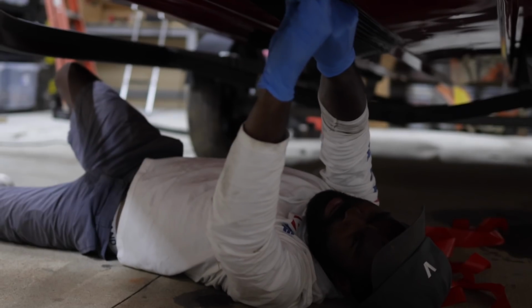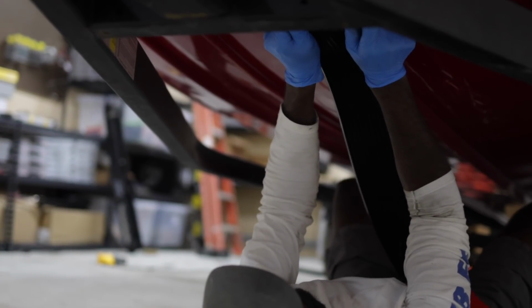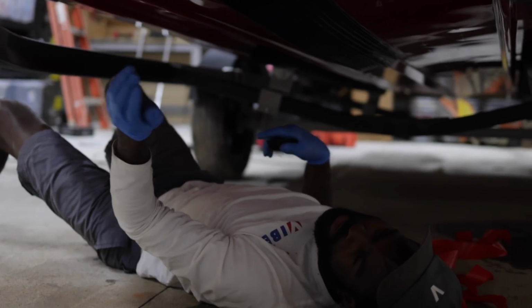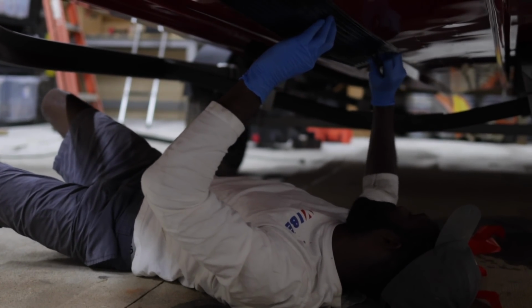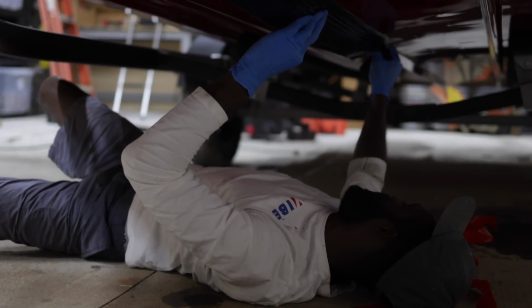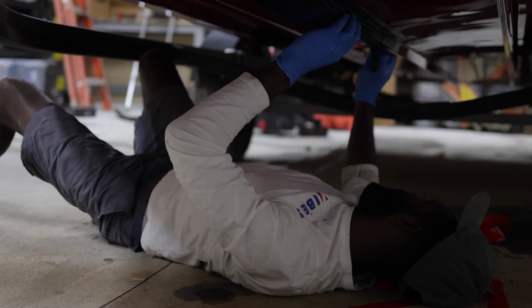Okay, but the material helps guide your squeegee along the material, and you get good contact. The other thing it does is it makes the keel protector itself really pliable, so it'll bend around. If you look on this keel protector, my midrib, that's a 1/2 inch vertical 90-degree angle coming off the keel. So that's really hard. If that material was just solid like that with no ribs in it, it wouldn't mold around the midrib that well. But the fact that it's molded the way it is, it makes it really easy to mold the product around the boat, no matter what kind of boat it is. It could be a jet ski.